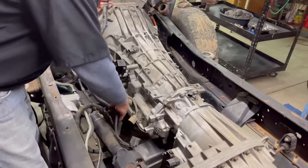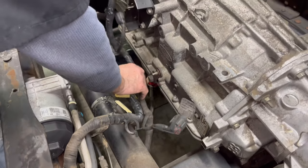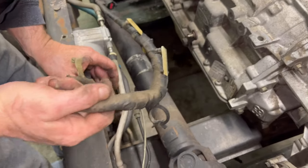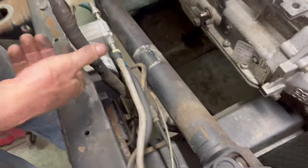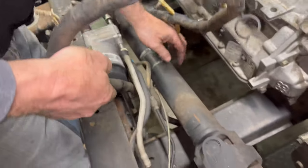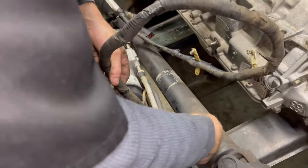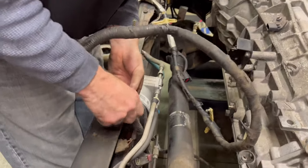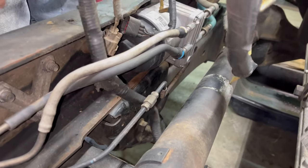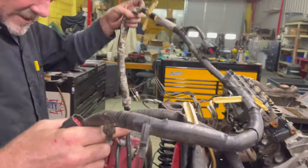We will go ahead and take the transmission harness very gracefully out of the truck so we can clean a lot of this stuff — the cleaner works wonders with these things. There's one broke off right there — see it? It's barely on. We need to tape that back on. It goes underneath the brake line and underneath the fuel line when it goes across the transmission crossmember — it goes underneath it. So just take your time and weasel through here; you can get it through all by itself. That is the transmission harness — that would make it brand new again.